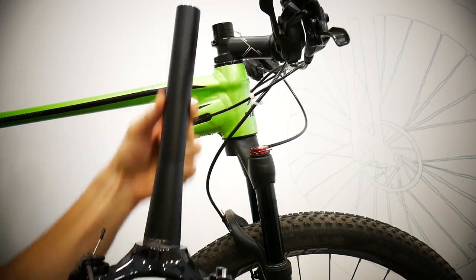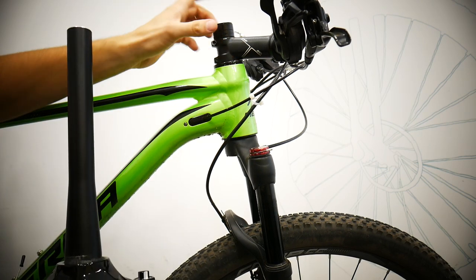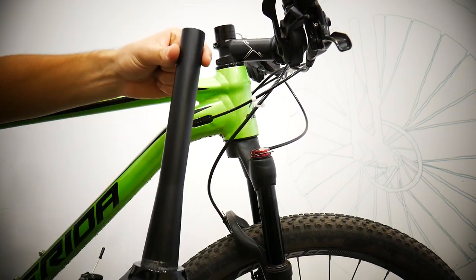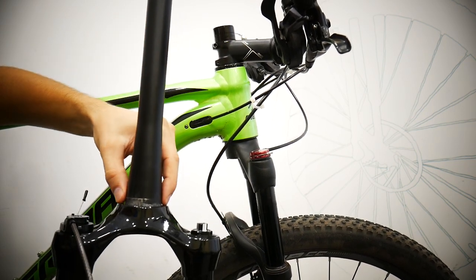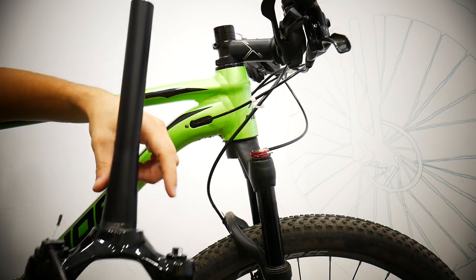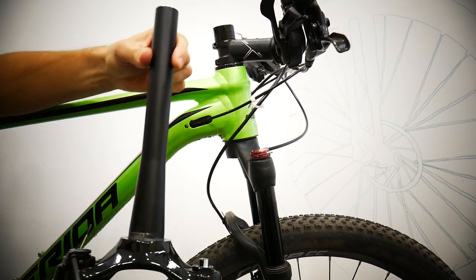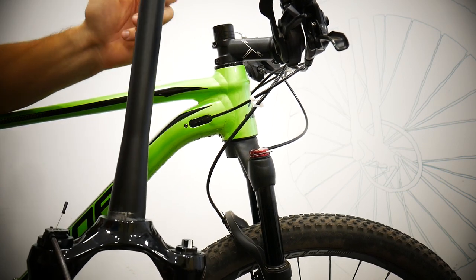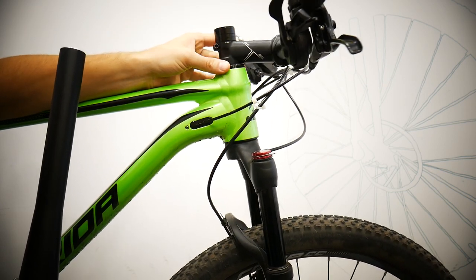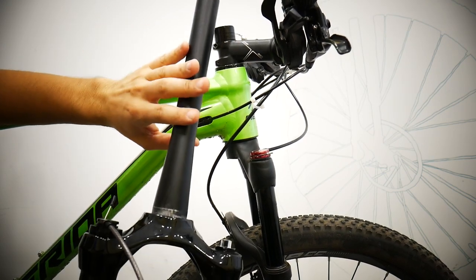The second thing is the diameter of your steering tube. As you can see here, we've got a tapered system. The upper bearing will be 1-1/8 inch and the bottom one will be 1.5 — so this fork will fit. Sometimes you have 1-1/8 by 1-1/8, sometimes it's 1-1/8 by 1.5, or 1-1/8 by 1-3/8. Make sure you know what kind of bearings you're using and whether it's a tapered system or a straight one. If you're not using a suspension fork — maybe it's a classic road bike — it might be a one-inch steerer. You can use adapters for your headset, but make sure you know exactly what headset your frame takes.